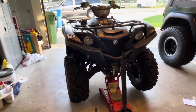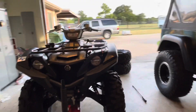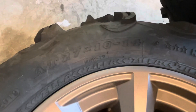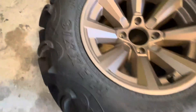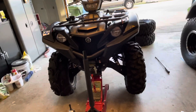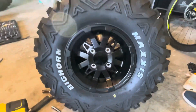It was an expensive mistake — I bought the square setup tires, the 28 10 14 Maxxis Bighorn 1.0, basically the same size as the factory 27 10 14. I didn't really like those; the diameter was okay but it made the steering too heavy for my liking. So I've decided to go with 26-inch tires instead.